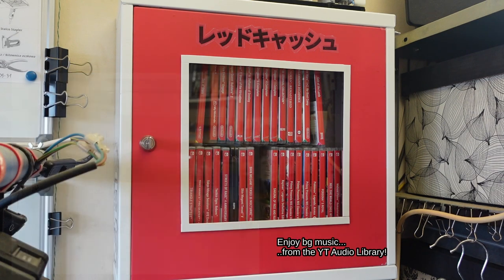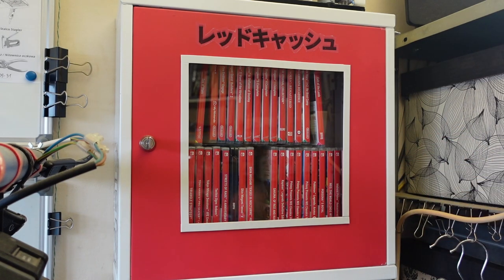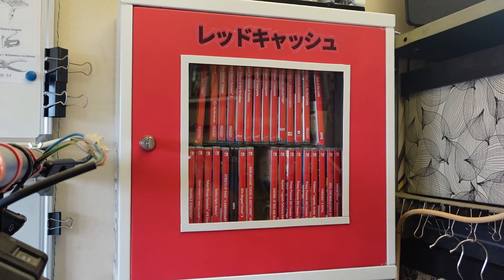What makes it a net rack and not just a shelf is that it doesn't have a back plate — the back side is empty. What you get, or at least what you're supposed to get, is a nice plywood board. The idea is that you first screw your networking gear and cables into the board, then attach the board to the sides of the enclosure. But in my case, all I got was a really crappy single-use particleboard of the lowest quality — if you screw something in and take it out, it just won't work anymore.